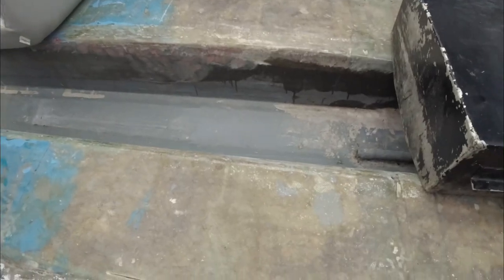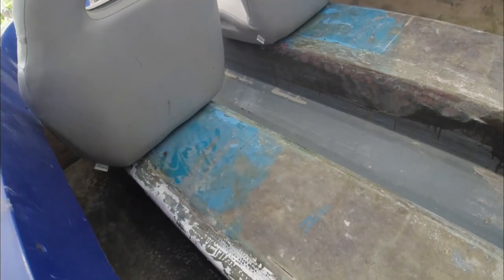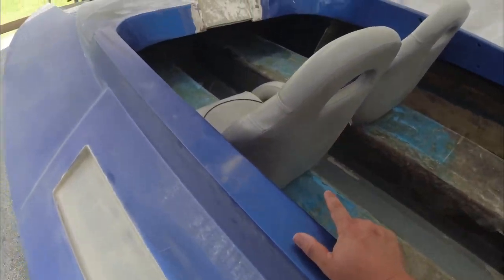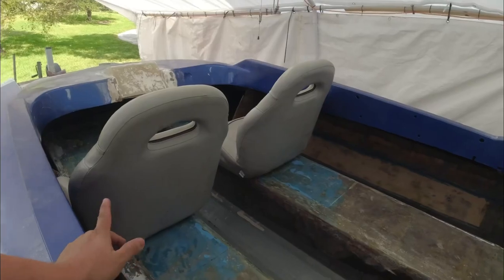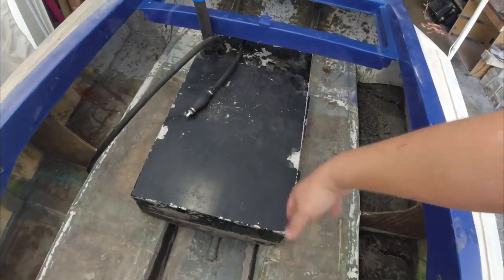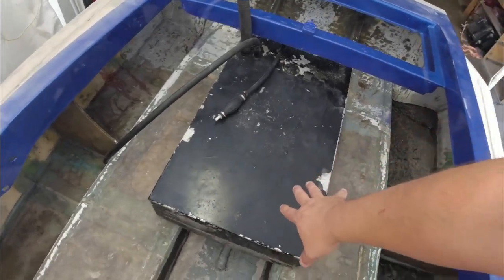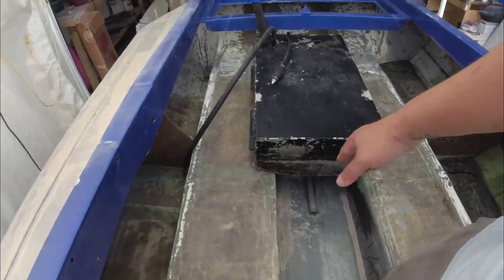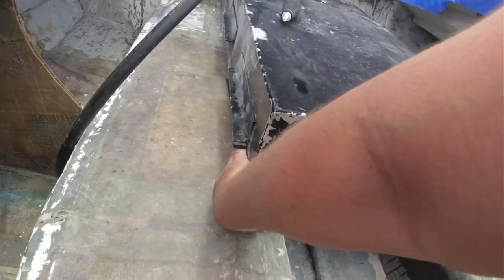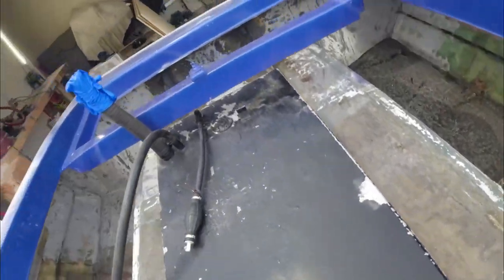I also want to put the floor in because I don't want to see this void, but I'm afraid to lift it any higher than I need to. These are the seats from my Checkmate, and this boat is getting all the Checkmate's old stuff - including the 32-gallon fuel tank. I'm planning to make the floor just up to a certain level so the tank can still sit partially recessed, and I'll build a frame for the tank on the side. I also need to cut the existing support beams back about six inches on both sides to make room.